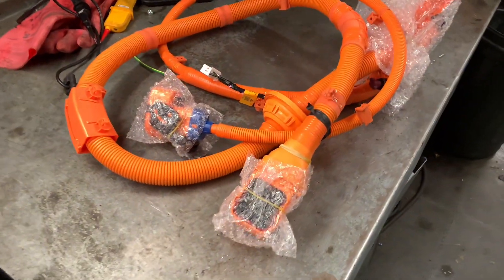What's up guys. In this video we've got a Hyundai Ioniq 5 combo inlet charger replacement. The reason for this is when the customer puts his car in for AC charging, the charger gets kicked out, but it is working on DC charging. We've got the part in, so we'll just show you that now.